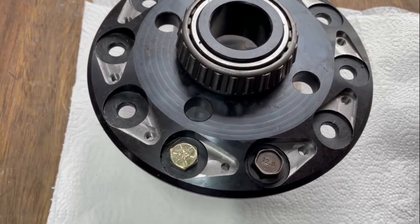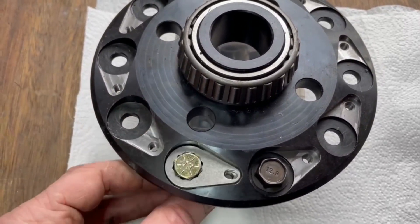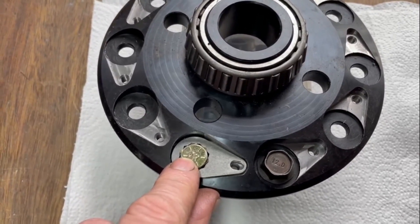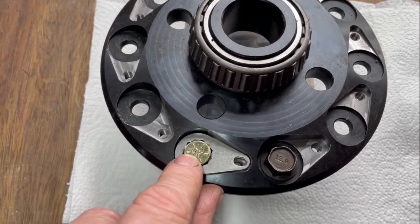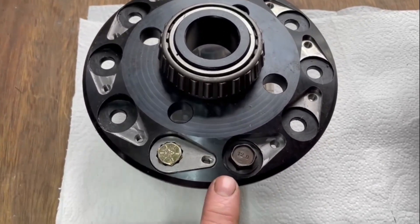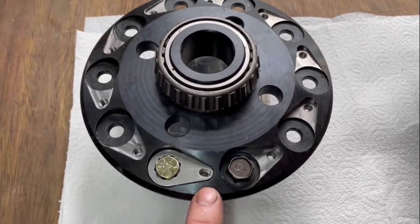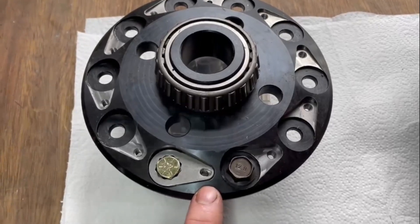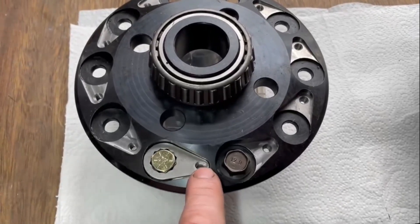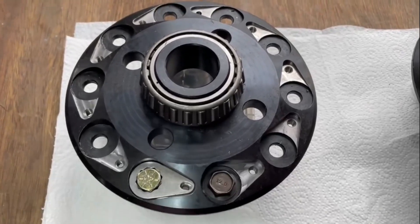The idea came to me when I saw a lorry with an indicating wheel nut sticking up. I thought if that was steel and it actually locked that bolt into place, and you put a little boot in there, then this bolt can stretch but it can't come undone - and it might just survive. We've done probably near on 300 tab lock conversions and we've had one failure, but that failure was the entire diff letting go: the crown wheel, the pinion, the centre was split in two, the gears were mashed, the cross shafts mashed. Actually only one of these broke off and sheared the stud - it was under so much tension. It works really well.